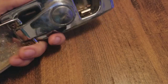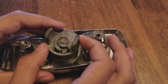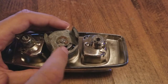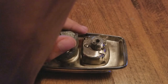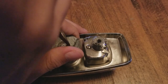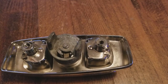Getting into it, you'll see there is a retaining clip here, and this is your clutch mechanism — it moves with the pawl so you are able to crank the window. To remove this c-clip, you can use a flathead screwdriver or a clip removal tool, whatever gets the job done without damaging any parts.